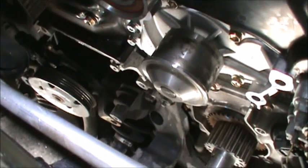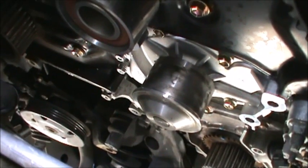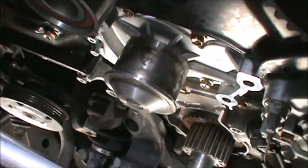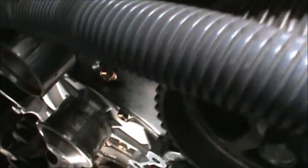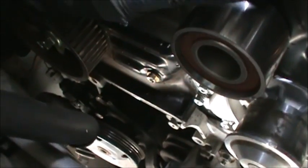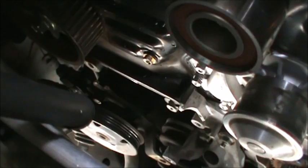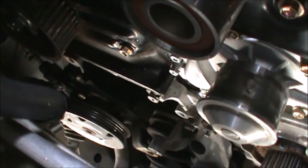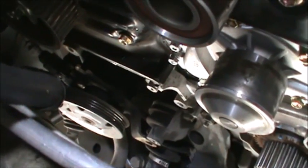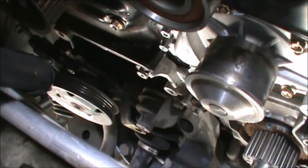The idler, and then we will put the belt, and then I'll start from down from the bottom, work my way up here, around here, up around here, down to that pulley, back around the back right over. Actually, I'll probably start with the back. No, I got to end up with the back over there, so I have slack on that end. And then I'm going to go below. Well, hopefully somebody holds tension right here. And then I'm going to install the tensioner itself. So let me do that.